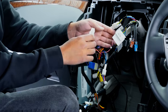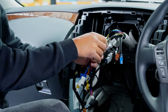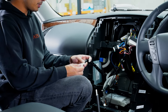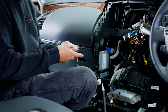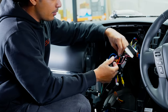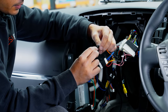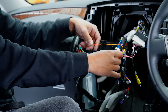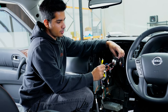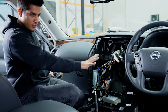Leave the spare plug for now just in case. Next, there's a plug that goes into where your hazard light was originally plugged in — plug that in on the unit, taking note of the tab as it only goes one way. There's also a little orange plug coming off the loom — orange to orange, one way only. For the camera plug, make sure it's the correct harness — the one you already plugged in — and plug that into the camera cable and tape it up.